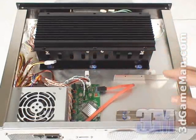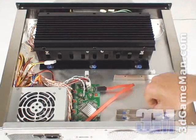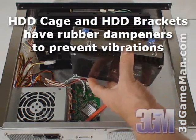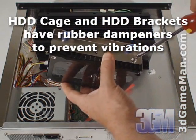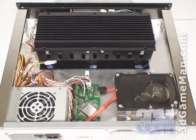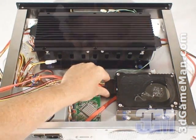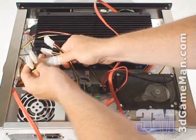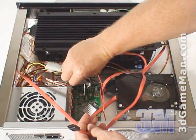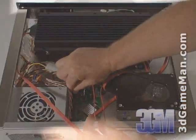If you have a RAID setup that requires five hard drives, you will need to install one hard drive at the back. Do so by removing the hard drive brackets, mount the brackets on the hard drive, attach the thermal sensor and screw it back into place. Now attach the serial ATA power cables to all the hard drives, connect them into the power supply and RAID controller board. Next connect the optional 80 millimeter fans if necessary and install the top cover.